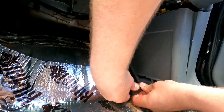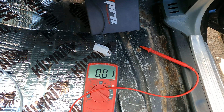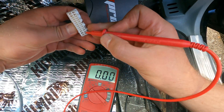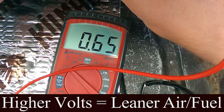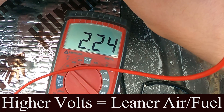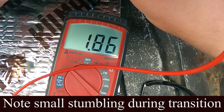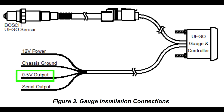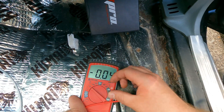I'm going to pull this ECM back out real quick, unplug this connector. Angel, I'm going to have you hold this to one of these seat studs back here. Dad, you start the car. Okay, punch that gas a little. That changed — that seems to be working. So it goes up in voltage every time we kind of let off the throttle. You can see it jumping. Now this is going to range from a zero to five volt signal. Right now we're running rich at 10.5, 10.7, so it's a really low voltage. So at least what I know is that the sensor is outputting voltage — I just need the ECM to read it. Okay, thank you Angel, that worked perfect.